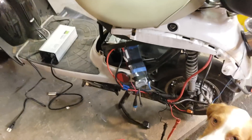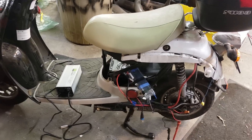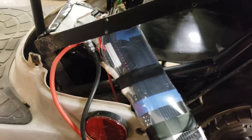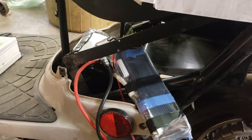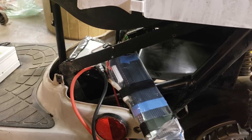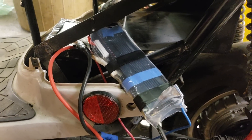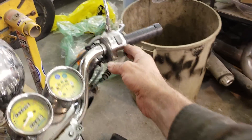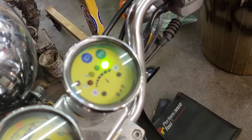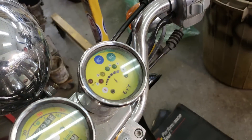We got the battery — I was super excited. It took two months to make, ship, and deliver. Then it took me two weeks to figure out that one of the little pins in the charging device — the battery management system — wasn't put together right, so all the lights weren't lighting up and the battery wasn't charging. Super frustrating, like learning a new language. I finally got it charged, but when I'd turn the bike on, the gauge would just flash and beep continuously and nothing else would happen.